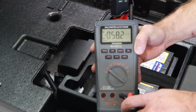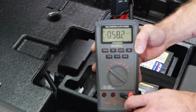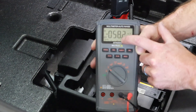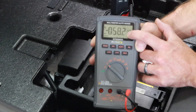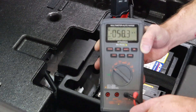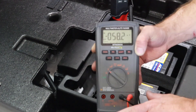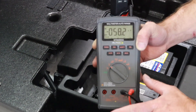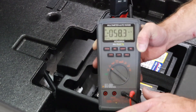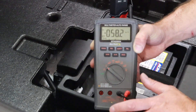Keep in mind the setting we're on with this clamp: for every one millivolt of output, we're measuring 10 milliamps worth of current. The quickest way to convert that is just to take my decimal point and move it over one spot. So here we're reading about 582 milliamps worth of current. Now I just had the driver door open and closed it, so there's a good chance this car has not gone to sleep yet. That's a key point in parasitic drain measurements — we've got to pay attention to service information and know what's happening with the car before we take a reading.